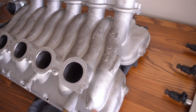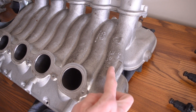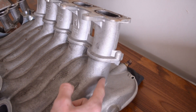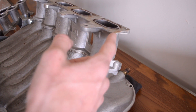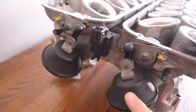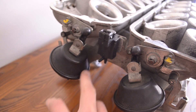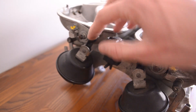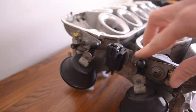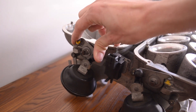Looking at the underside of the intake manifold, you can see how the low-speed port feeds from across the plane of the manifold into the engine. Once the butterfly valve is open, the runner becomes dramatically shorter for high RPM operation. On the left side there are two bulbs that actuate the butterfly valves — you can find these on a lot of Audi 4.2-liter motors, so if you have problems, check the Audi 4.2 first. If you have any sluggishness issues, check the small plastic clips as they tend to break, and verify that the lever arms are actuating properly and aren't misaligned.